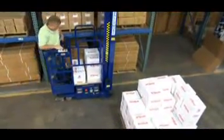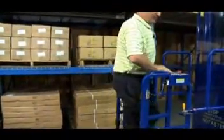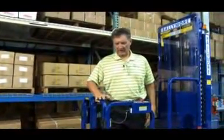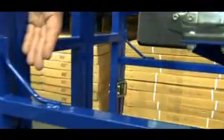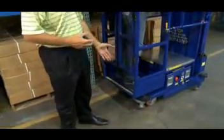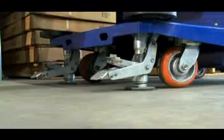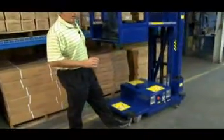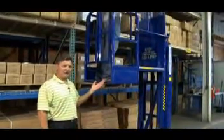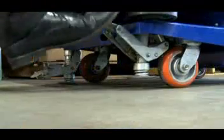The lift is equipped with saloon-style safety gates, manufactured from inch-and-a-quarter square tubing. They have heavy-duty springs that allow you to step in and automatically close. The lift is equipped with two points to connect restrictive tethers, and heavy-duty floor locks. The floor locks are electrically integrated with the lift — the lift will not operate unless the floor locks are engaged. Once the floor locks are engaged, the lift can be raised. In the event that the floor lock is inadvertently released while the lift is going up, the lift will stop going up and an alarm will sound. At that point, you can lower the lift to re-engage the floor lock.